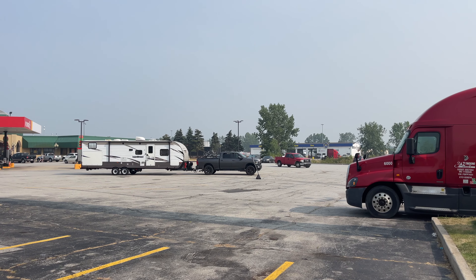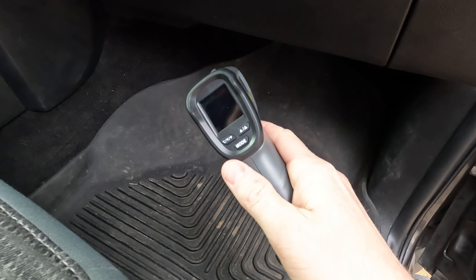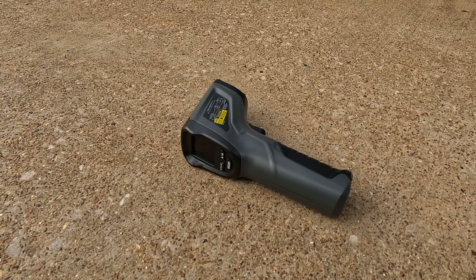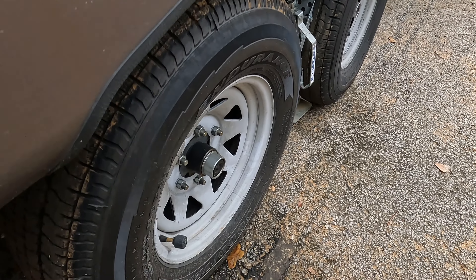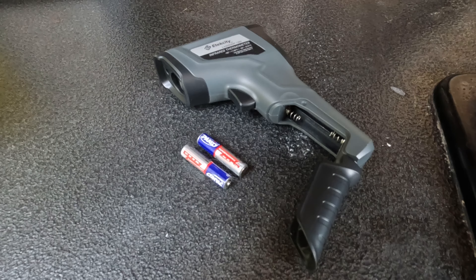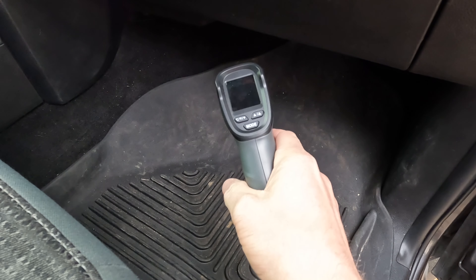Going along the same vein of safety — being able to tell if you've got an issue with your trailer, be it the brakes malfunctioning or the wheel bearings going out — having an infrared laser thermometer to walk around and check all the hubs on your trailer is absolutely priceless. Variances in temperature between those different hubs can really indicate if there's a problem you need to address. It's super simple to take a laser thermometer each time you stop for fuel to check the hubs and get a consistent temperature reading — know if one hub is getting hotter than another. Try to find one with a ubiquitous battery, AA or AAA — a lot come with 9-volt batteries, which is just one more thing to carry.